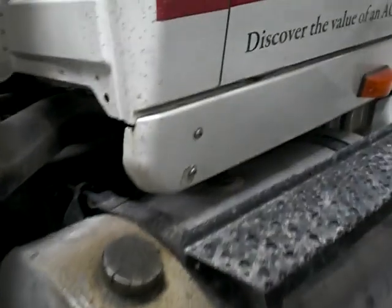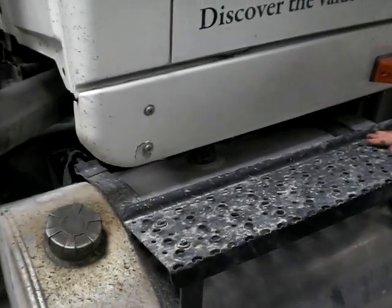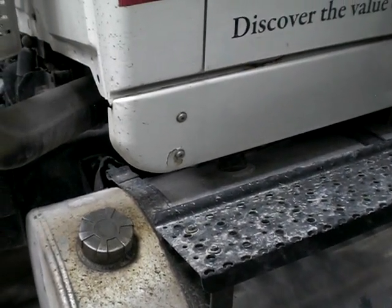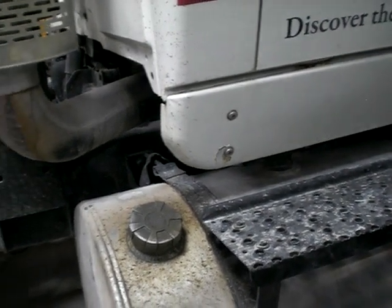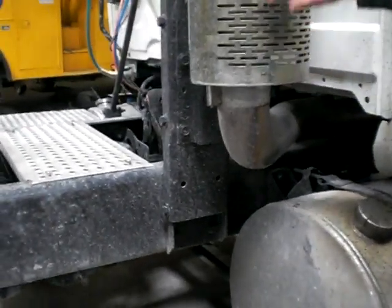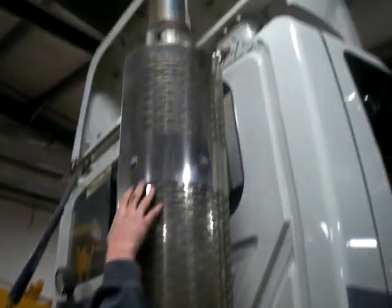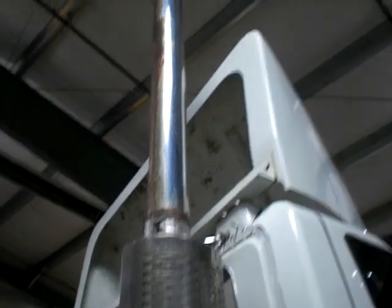I'm going to walk up a little bit to see if there's any excessive smog, because my exhaust should have all exhaust wrap, no leaks. It's properly mounted, secured, not cracked, bent, or broken. And I'm going to follow the entire path of the exhaust to see if there's excess black smog all the way up, and there should be no pinhole leaks for the entirety of the exhaust. And the corrosion up there is just due to excessive use from the fumes coming down. It's not anything wrong with the system. And I would report that to maintenance.